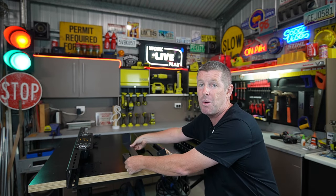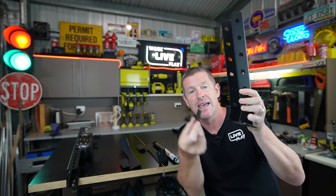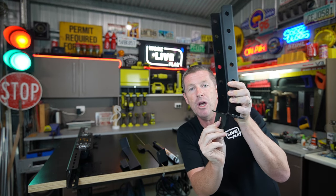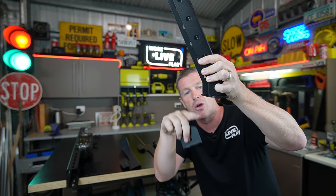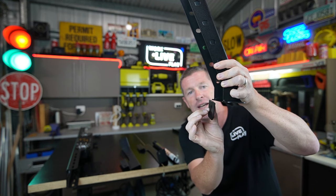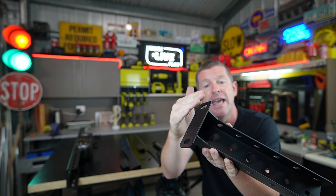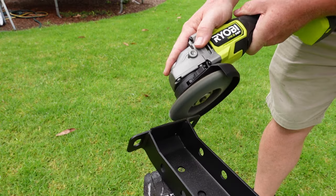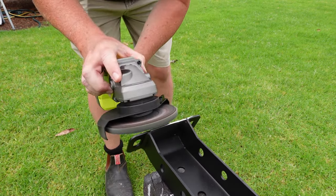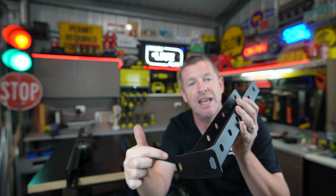Now we'll get onto the modifications required to fit the King's Tub Rack onto a roller shutter — it's really pretty straightforward. So this is the bottom leg. When you get it from King's, there's usually a little leg or tab that hangs down from the bottom. What you do is essentially cut this little tab off. The idea is that the foot sits on the edge of the tub, gets bolted from the top and through the side as well for extra support. I just run a grinder with a cutting wheel down the radius section of the bottom of the foot, then come back with a flap disc to round it all off and smooth it.